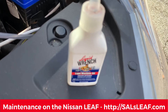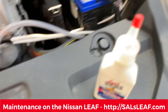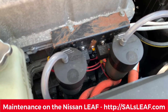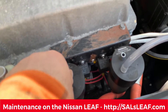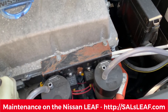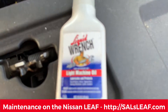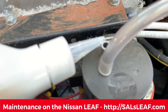It's time to add some oil to my car. You may ask, but you have a Nissan Leaf — where do you have the oil? Well, I have air horns, truck horns, and these are the compressors. These compressors require some oil every like six months, about five drops. They use this Liquid Wrench light machine oil, and you put it right inside this thing.